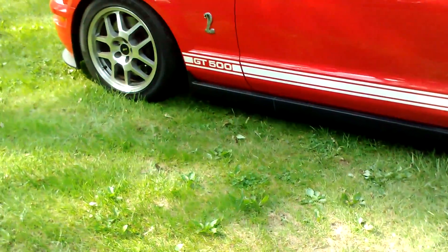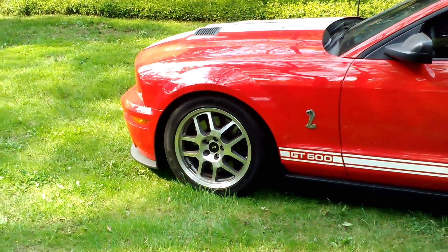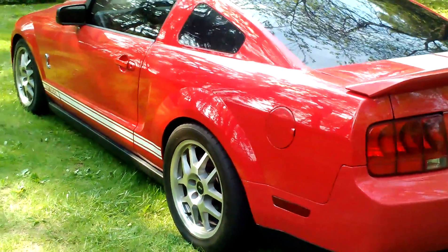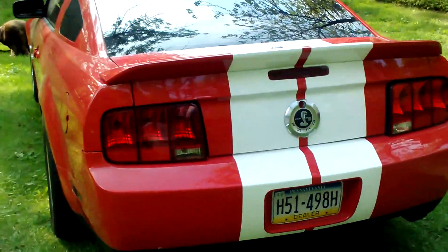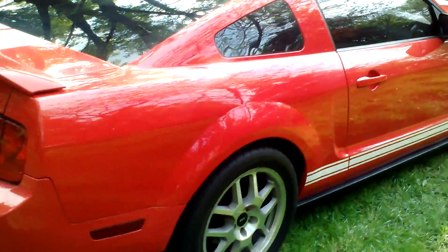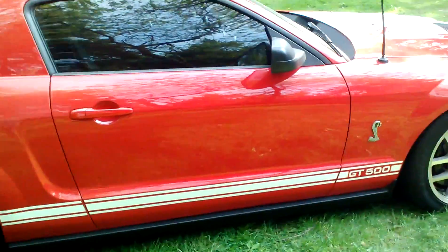The tires are inspectable. Now, with the long tube headers, they don't have a place for the O2 sensors, so the engine light will be on because of that. You can do one of two things: you can get from JEGS or Summit the weld-in O2 sensor bungs, weld them into the header, and screw in your O2 sensors — that takes care of the problem. Or, for $60, they have a bypass that you plug into the current system and it just bypasses it. I never messed with it.